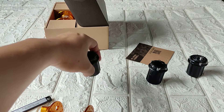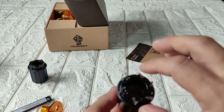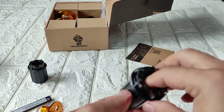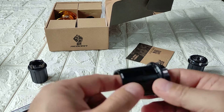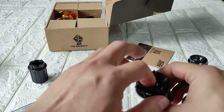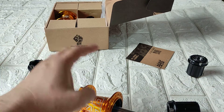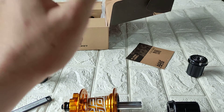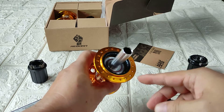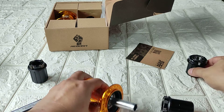Maybe next time — if I can find some time and a press tool — I'll try to install the bearings back. It's really hard; I managed to remove the bearings on this freehub but it took me several hours. I'm trying to find a tool to install them back more easily. Give me a few days or weeks and I'll try to upload whether I can replace the bearings on this and install it on the cruiser. I'll also try other hubs I have. For Shimanos, you don't need to do this mod — it definitely won't work because Shimanos use cup and cone. For the Micro Spline they do have sealed bearings, but I don't know how the internals look.